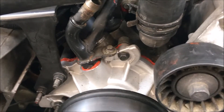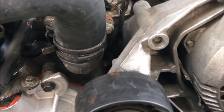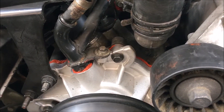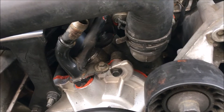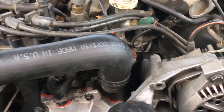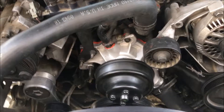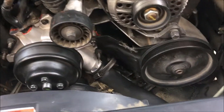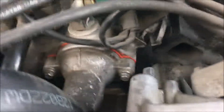That's one of the tricks of the trade to get that water pump off. I thought I'd share that because I remember this water pump being a real pain when I was removing it because of all the stuff you had to get out of the way first. That's how you do the water pump on the Ford 3.8 V6, which they put in a lot of Thunderbirds, Ford Tauruses, Mustangs, and some light-duty trucks. They are usually behind the accessories to access those bolts.